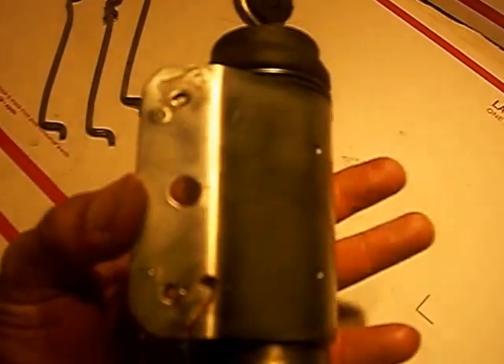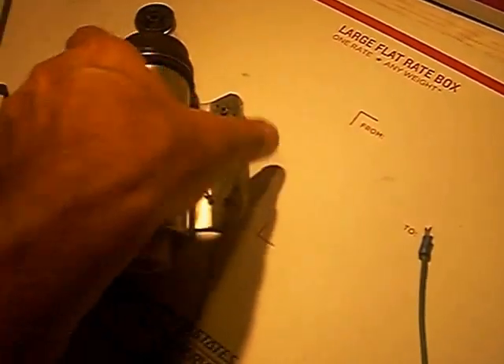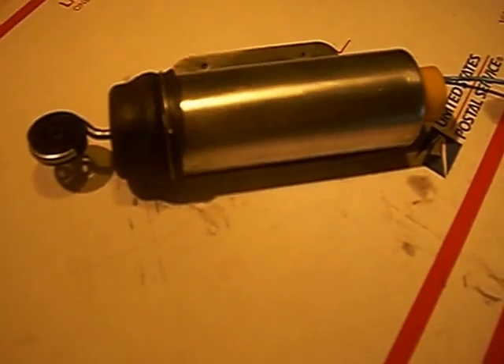As it would be mounted in the door, this would be the outside facing the curvature of the outer skin of the door. This is 1969 specific for the Cadillac DeVille and Eldorado, with two mounting holes as opposed to the three mounting holes used in 1970. Although it can be used in 1970, it was designed and is the superior correct part for 1969.